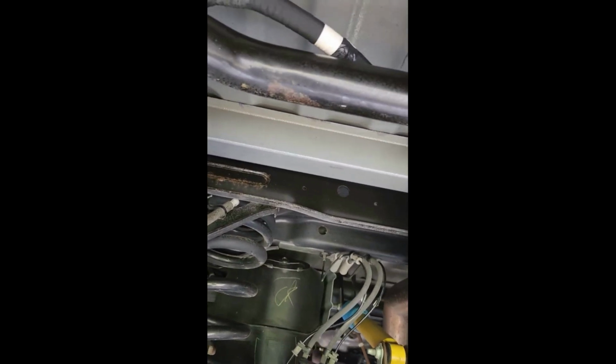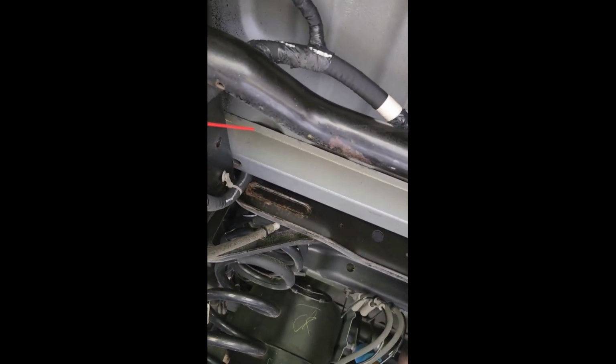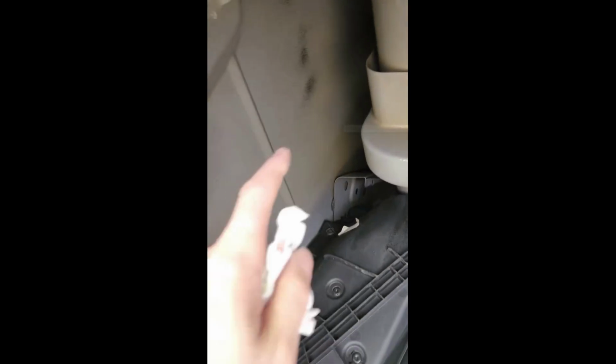But the important part is we got in this one, inside those little holes up there, and those little crevices right there, the corrugated part, there's spot welds on each one of them holding this bed on. That's where it starts to rust at. And up inside this wheel well, we actually spray with a wand way up inside there. So it's going to run down the inside of that fender and lay in that wheel well inside there and keep that from rotting out. The stuff works great.